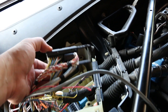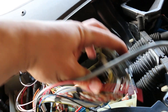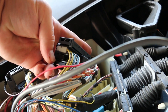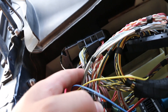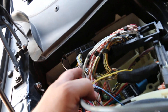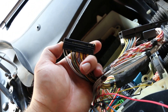Now we get to work on this side of the harness. For this, you don't have to remove the slider at all because the pins come out right from this side. It's the same process — slide the connector out with the pick tool while depressing the clip, just like you did the other one. After removing this longer black sub connector, locate pin number 25, which should be an empty slot. This side is labeled starting with 23 and ending with 44, so go up from 23 and count down two spaces to the empty slot.